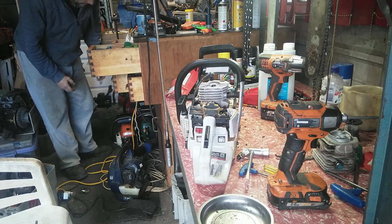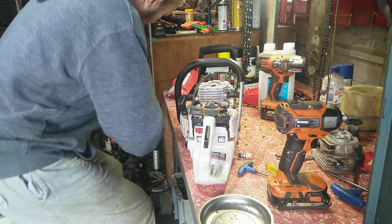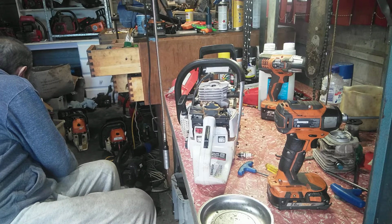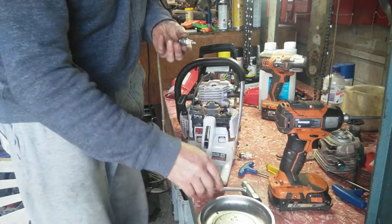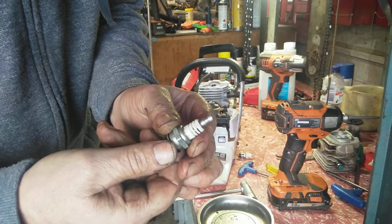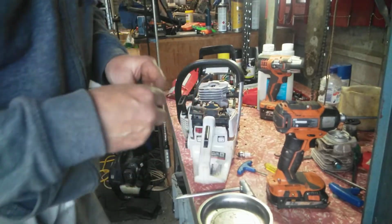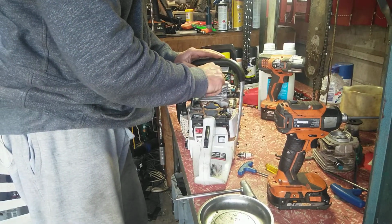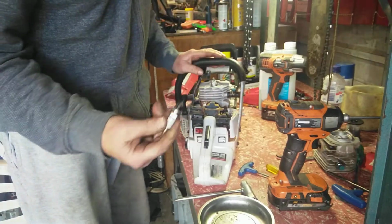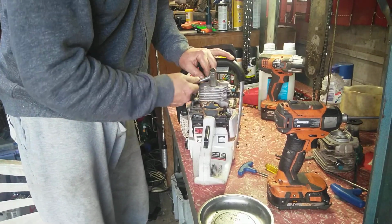What kind of pitch? I'll get one out of there, that's a good one. Most of these saws will take an NGK BPMR7A. It's the right heat range for Australia. I've done some work in lawnmower shops, so I had to get service saws and stuff, and occasionally I took stuff home from out of the bin. But I do not trust these, because we had to pull them out all the time, like crap. They work maybe alright for about 6 months, and then it's hit and miss, you just can't trust them.